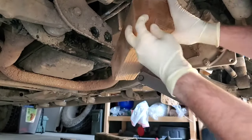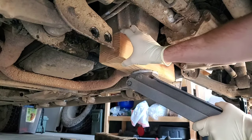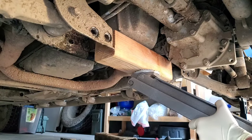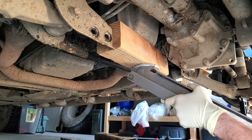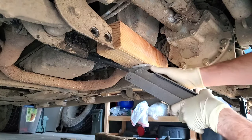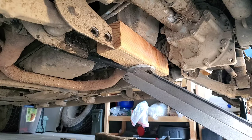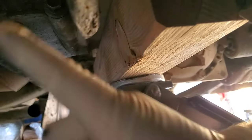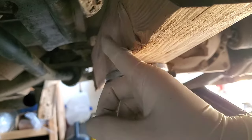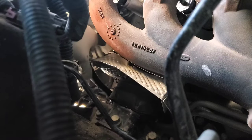There we go. That opens up the bottom of the oil pan so you can get your block of wood. This block of wood is way too big — got caught on the axle. I do like using 4x4s, but it just didn't work out this time. We ended up having to use a 1-by-something — same kind of principle, just not a 4x4. It should look something like that. See where that cross member would have been in the way? Make sure you stay on the flat part of the pan — you don't want to get over where it's grooved with the oil drain plug and the sump.